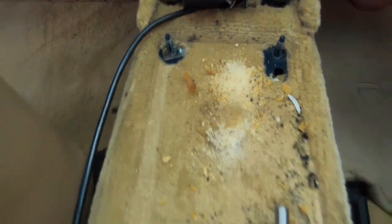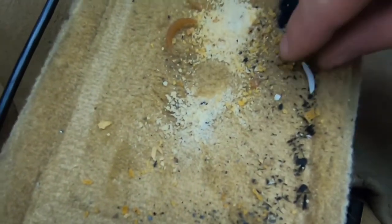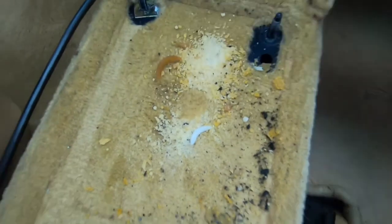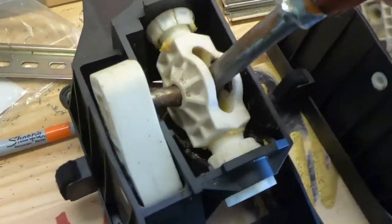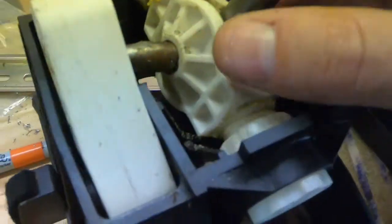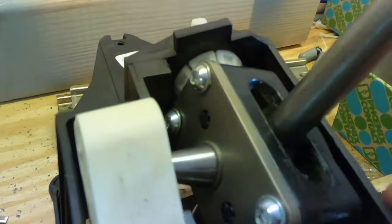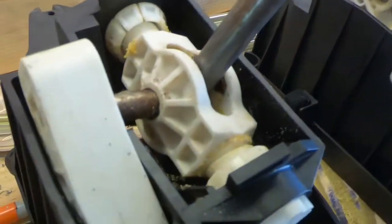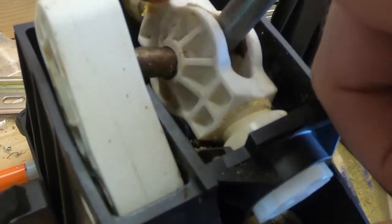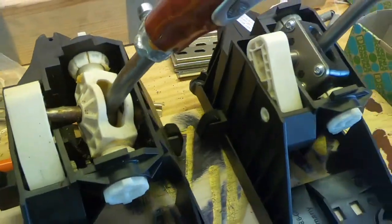There's my old bushing. This is the old bushing — that's the garbage mess. Got the old one out and you can just see how blown out and disgusting it actually is compared to the GT3 one. The GT3 one has metal bushings and an aluminum plate, all aluminum bits, compared to the old worn out polyurethane and plastic bits that were alongside my factory one.